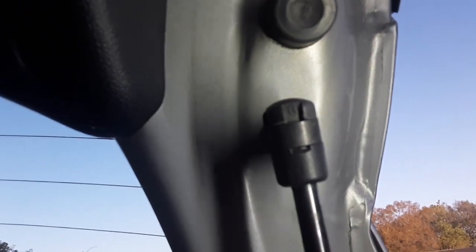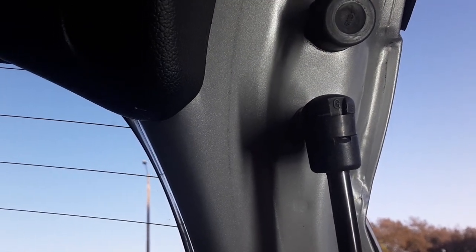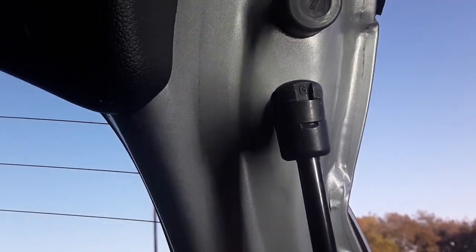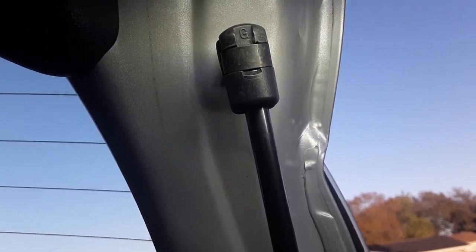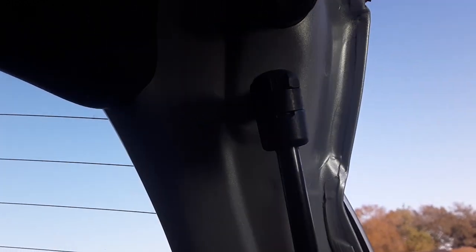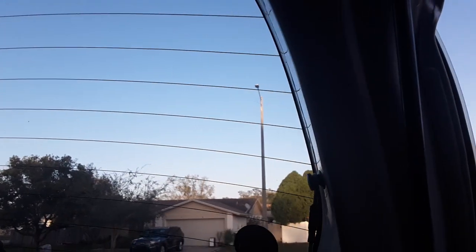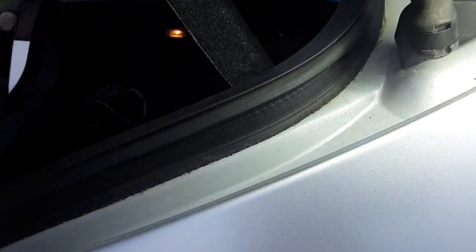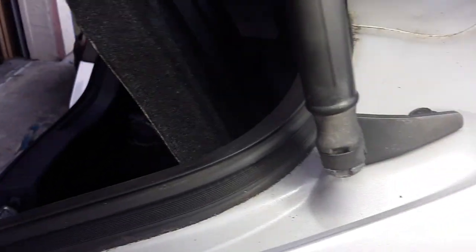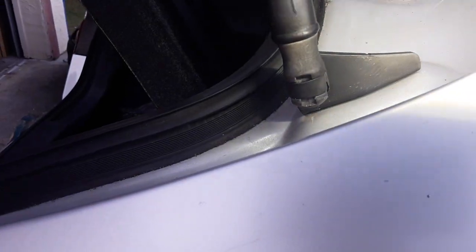All right, with some light on the subject - see that clip right there in the middle of the screen? That little clip on the bottom and on the top - that's where you're going to stick the flat-tip screwdriver. You're going to want to just slide those clips up to the very top of the head of the piston, and that will allow it to come away from the little nubs it's attached to on the car. Same thing with the bottom one - you stick it in there and it comes undone, then you just slide it up until it's even with the head.